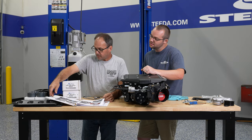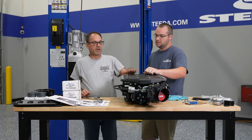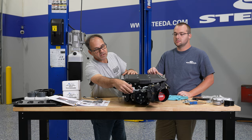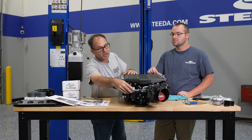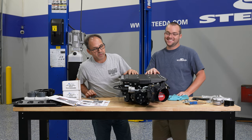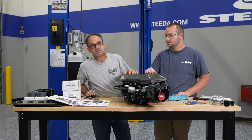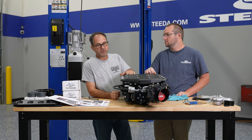As for the rest of the blower install, one thing that Edelbrock notes is: when you're doing this install, do not actuate the bypass actuator. Don't pull the rod, don't try to make it work — it works by vacuum and air pressure only. Don't try to manually pull this or adjust the set screw. You'll only screw it up and have the potential to blow your motor. It can cause it to either open too quickly, which will cause you to lose power, or it will cause it not to open at all, which can cause overboost — and bad things usually happen as a result, because their tune is not set up to deal with overboost conditions caused by a stuck actuator.